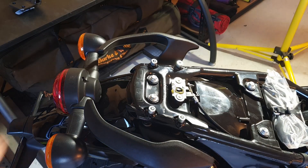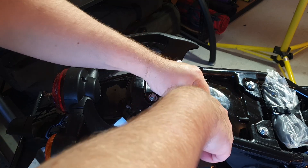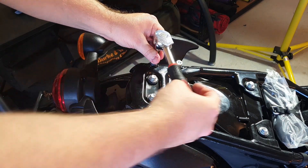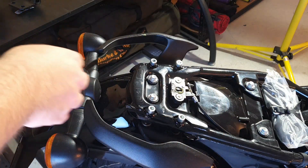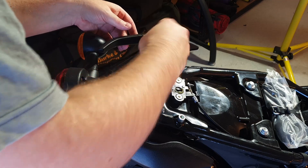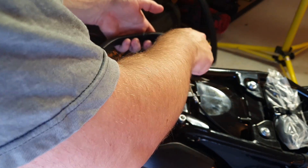Once the seat's been removed there's four hex topped bolts that you have to remove. Just loosening off these four hex topped bolts. Once that's been done you can just undo them with a finger. There is a nut rather at the end of the bolt which you can hold in place with a couple of fingers from underneath if you need to. I found it pretty easy to just undo them and the nuts kind of fell into some small recesses that seem to be made for them in the top of the fender anyway, so it worked out well.